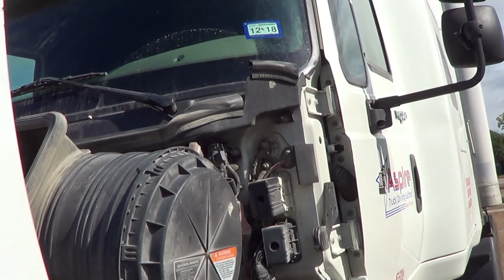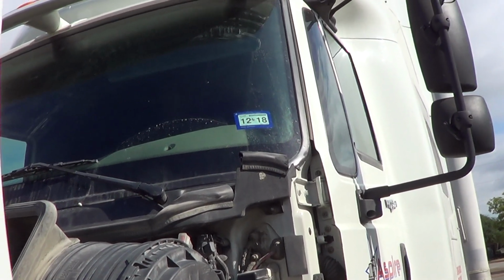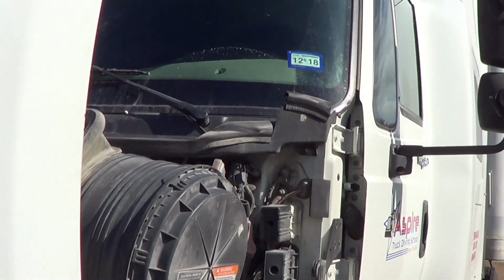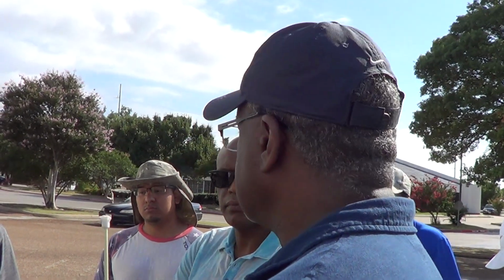After you say any of those, after you say bent, broken, or damaged, or clean, clear, not cracked, you should always follow up with securely attached to the vehicle. If you need to say no illegal welds, you'll say no illegal welds. And then there are certain things where you have to add something extra, like on the slack adjusters. You know, with brakes released, you cannot have more than 1 inch of play. So you'll learn those as you go through.